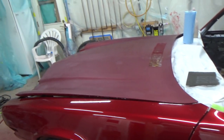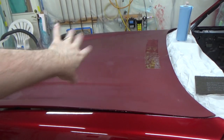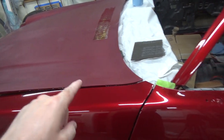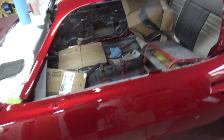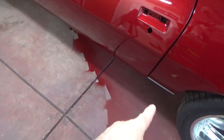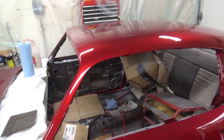Plan of attack: this will be done this weekend, and then it's got to sit for a couple of weeks before we flow coat it. While that's getting ready for flow coat, we'll be sanding piece by piece. I'm not quite sure how I'm going to do this given the state of the car, but I'll probably do this fender and the two doors, flow coat those at once, and then do the back all at once. I also have to do the black at the same time. I don't want to do the whole car at once just to minimize the chances for trash to get in the paint — I'll do it a piece at a time.